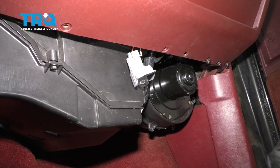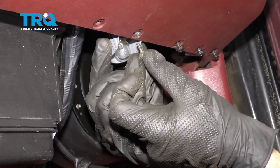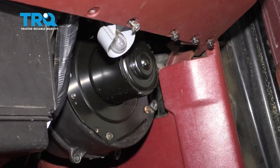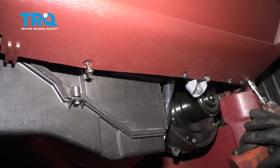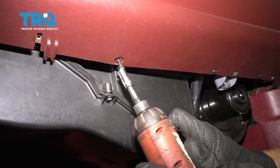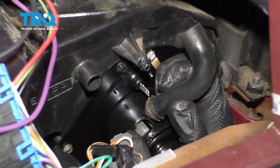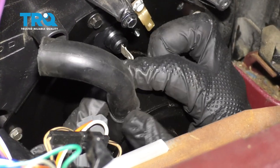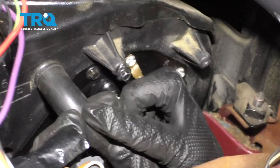Move along to putting in all the lower screws. Take the screw that looks different — that one screws in on the other side of the dash. Once they're all started, snug them up. Now get the hose on — take this end and put it down into the blower motor, give it a little twist to make sure it's completely seated, and then take the other end and slide it over the box.